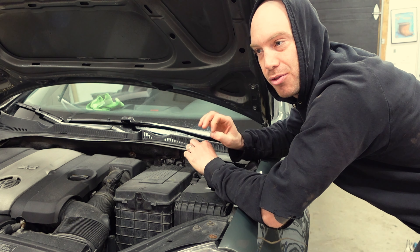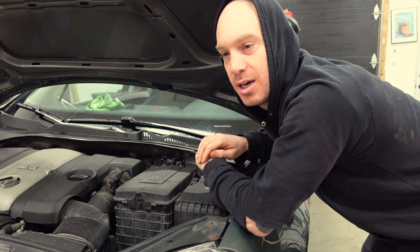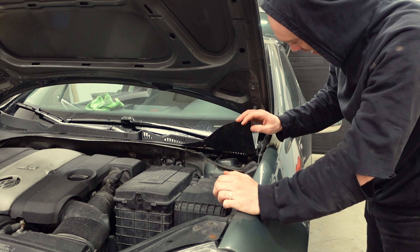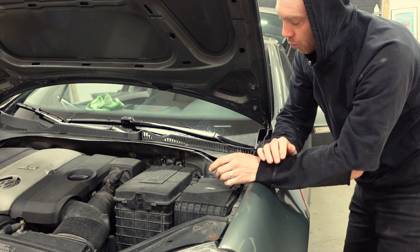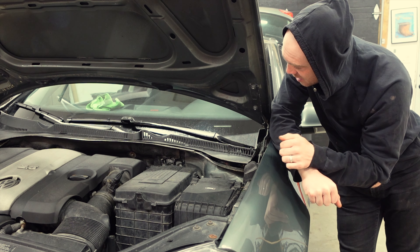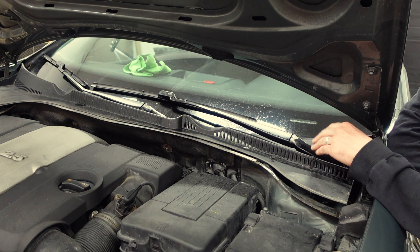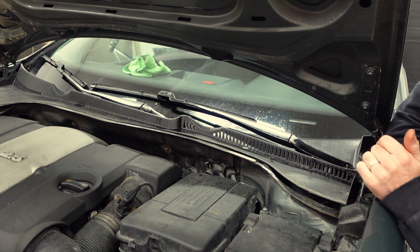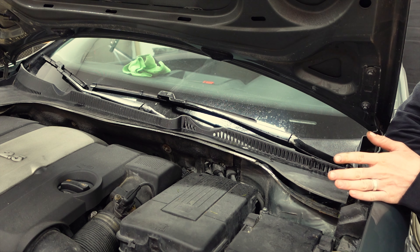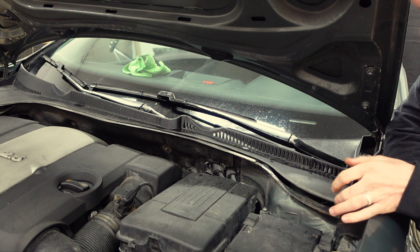When I was talking about wanting to throw these coilovers on while we were doing the exhaust with Dave at CL Motorsports, Dave was less hyped on the idea because he knew how much time the exhaust was going to take and the probability of problems occurring. The first thing he said was these three bolts that hold the top strut mount on can be a real annoyance — he thought they'd probably break. Problem is, the wiper arms are pretty stuck on here. I don't want to hit them with a hammer and wreck anything, but I remember for a safety inspection a while ago they actually had to get a strut replaced and I think they just broke my rain tray and zip tied it back together to get to these three bolts.